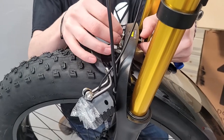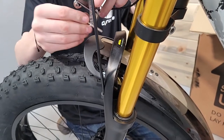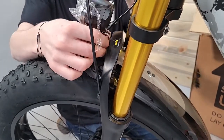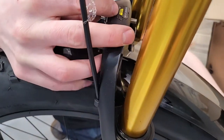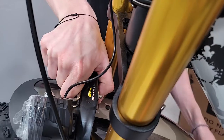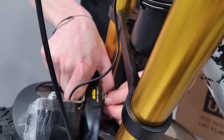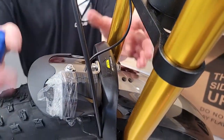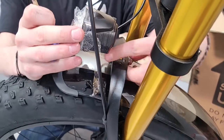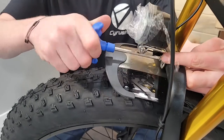Then we found the easiest way to put these on is to do the light first on the outside. And it doesn't matter, you can do the light on the back if you like. We just do the light on the front, and then this tab on the back of that fender acts as a nice washer. Let me see if I can get it. Yes. All right. Got that pinched. Okay, so I've got that nut started. And I'm gonna hold it with my fingers, and then I'm holding up the light so it's in the right position as I...